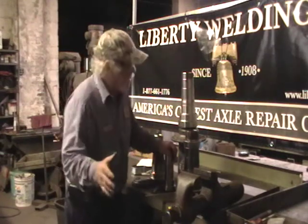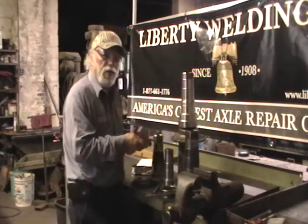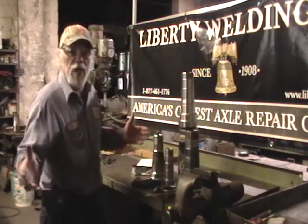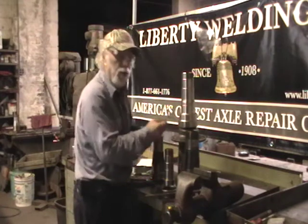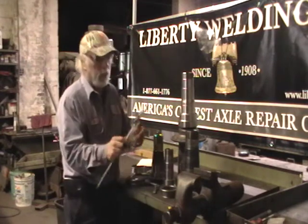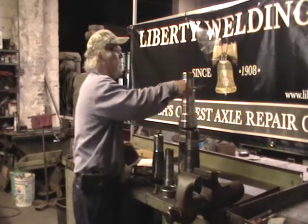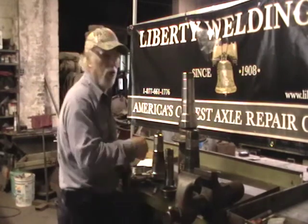The other thing I've got a beef with is spindle gauges. People are selling these gauges — one plate, check one journal. What are you going to do with all those plates? People don't like cluttering up their toolbox with all these gauges you don't need. In the machine shop here, we've got micrometers — you can use a micrometer to check it all around and see how much wear is there. Another thing you could buy for probably a hundred bucks is this deep-throat dial indicator. This will go up and check up to a four-inch diameter — it will check all these journals. You don't have to spend all that money for somebody that says go or no-go.